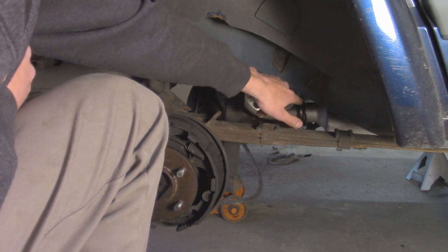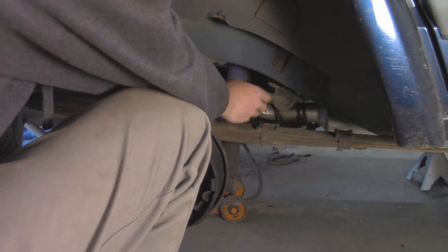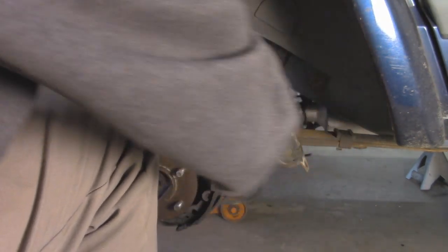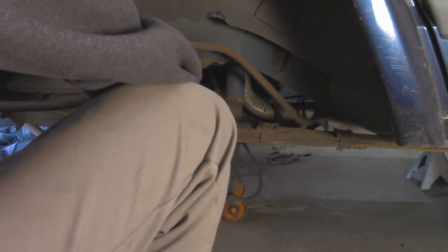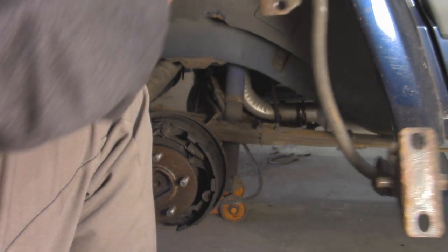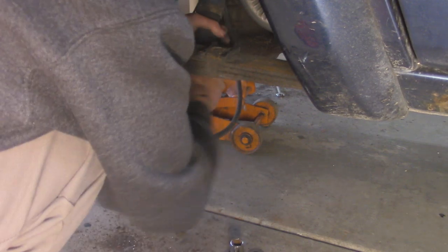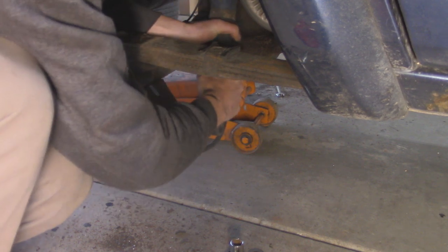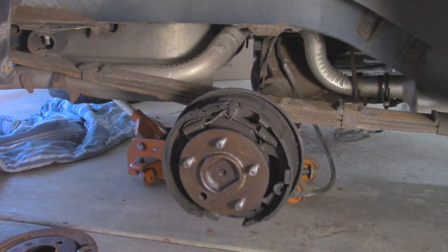With the U-bolts removed on both sides and the two 15mm nuts undone on both sides, we should be able to fish out the sway bar. It might be kind of difficult — you've got to basically work it around the exhaust and the drive shaft. And that's our rear sway bar out. The next thing we're going to do is remove the rear shock. Now we just got to get the upper shock bolts and this axle should be ready for us to drop it down. I wasn't able to film up underneath on the top side of the shock because it's a little bit hard to get in there, but eventually we got that off on both sides.